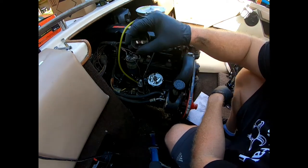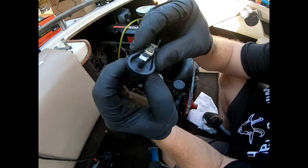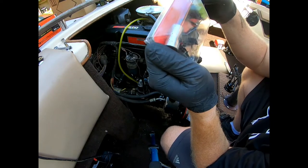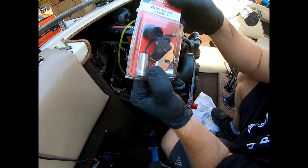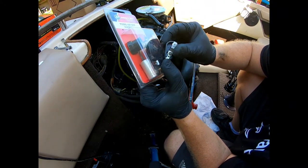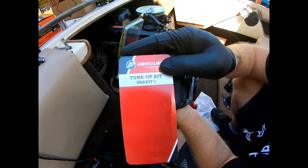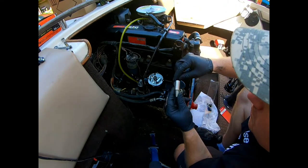There's the old cap. Put the little bracket on there for those two. Here's the rotor — a little bit of schmutz on there that came right off. We got a brand new kit to put on, although I just noticed the rotor in the new kit is smashed to bits, so that kind of stinks. Looks like we'll be using the old one again — doesn't look too bad, luckily. There's the part number for it. Get the one without the broken rotor.